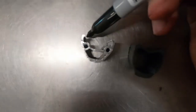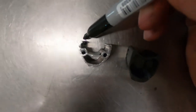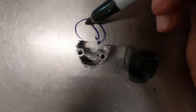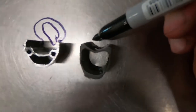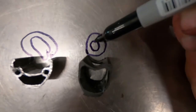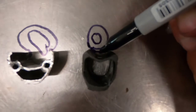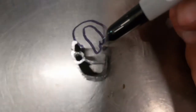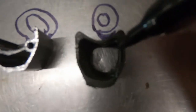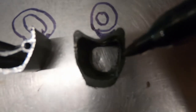So the fundamental problem with carbon clincher rims is it anchors off that part of the rim, and then the tire obviously gets inflated and anchors into there, and inside you have an inner tube. On the carbon tubular, what you have is a solid tire with an inner tube in it, and that then gets stuck onto the carbon rim with carbon cement or tape. And so what you have is a lot of force on these brake track walls and no support going across them, where on the carbon tubular you have one solid bridge and then you have the brake track underneath that.